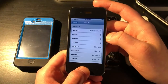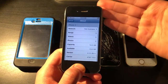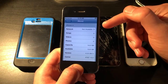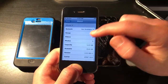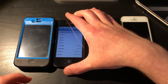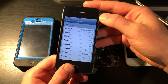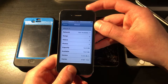But what's special about this one, apart from its very unresponsive home button, it's on iOS 4 — specifically 4.3.5, which is basically the last version that was released of iOS 4. Of course, I saved SHSH blobs for this. And earlier, when it was at the iTunes screen, that was actually just the iOS 4 setup. I completely forgot that iOS 4 needs iTunes in order to actually boot into the operating system. iOS 5 and above have the setup like we did on the 5s, but this just needed iTunes in order for it to set up. I spent a lot more time trying to figure it out, because I completely forgot that.